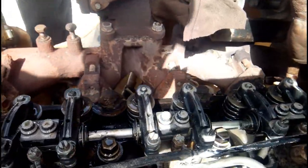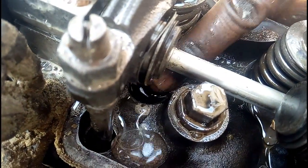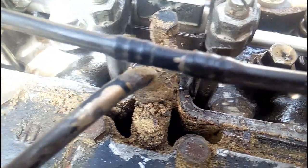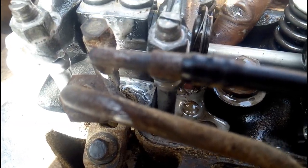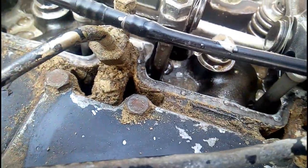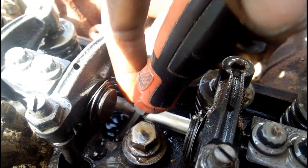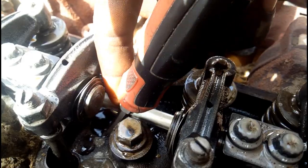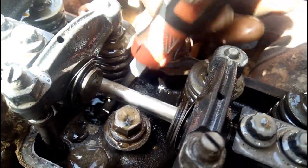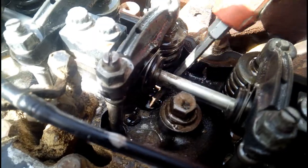The water is coming out through the cylinder head water jackets. Once the water jackets are damaged, water enters the engine oil — as you can see. I put my finger here on this side — it's not going through. On the second side I put my finger and my finger is almost there. This area is the water jacket area, which is the one that blocks the water from coming to the engine oil side. As you can see, this water jacket is already removed — it's damaged. That is why the water is coming out from there straight into the engine oil.